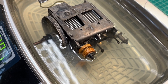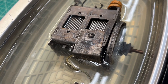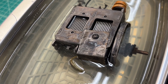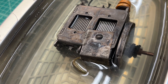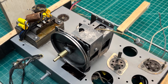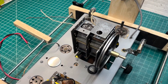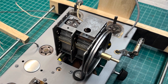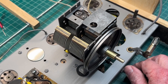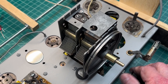Now a new batch of citric acid and using the ultrasonic cleaner, probably about five cycles or so, and doing some last detailed cleaning before taking it out. Doing another great rinse, and as you can see, getting it lubricated. New grommets, a new dial string.